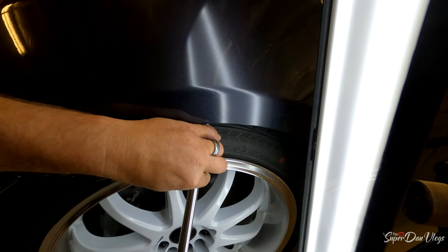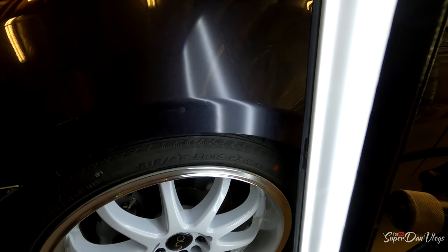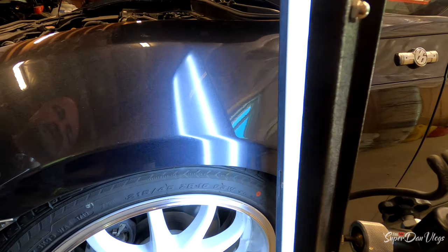It all depends on how hard the car was hit. On a hard body line you can certainly weaken the paint right there in that one spot. So if you're not careful you can either crack the paint or make that repair look messed up. But it's going to take a little work. The metal does travel when it gets hit — so it not only goes in but it can also go up and out, and it can leave a big crown.